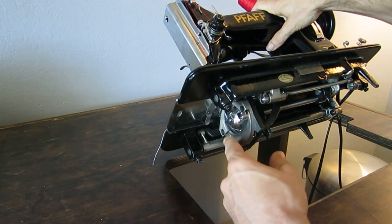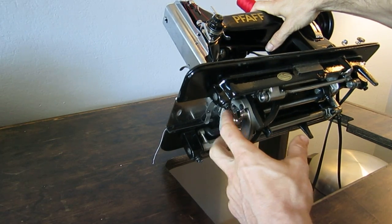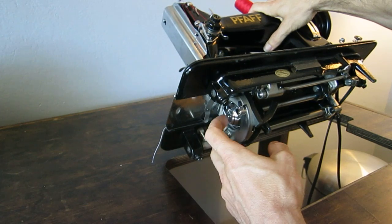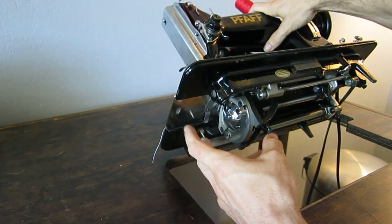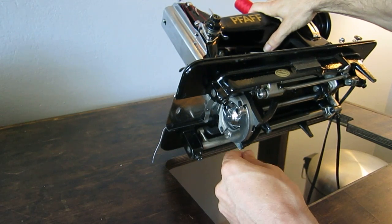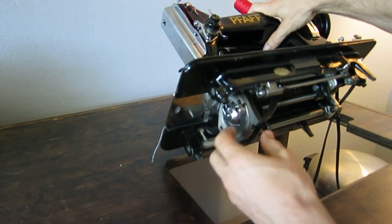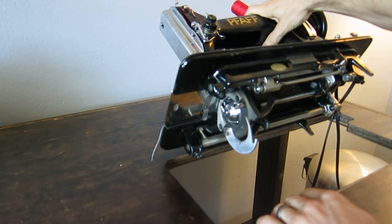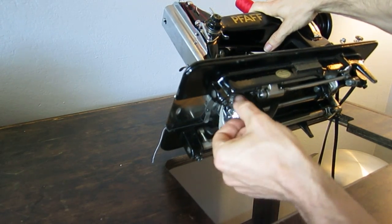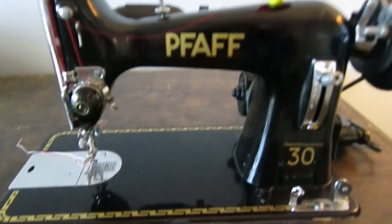This one is really unique in its design — really well engineered. When you want to clean out your hook, clean this whole area, lubricate and maintain it, this is probably one of the most critical components since it's what forms a stitch. On all the other machines I've encountered, you have to remove bolts and multiple pieces come off. This one is unique in that you just loosen this wing nut back a turn or two, and the whole assembly swings down, allowing you to pull out the entire hook assembly at one time, which is really convenient.